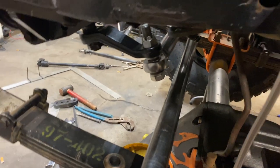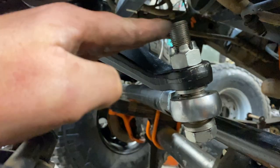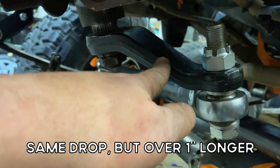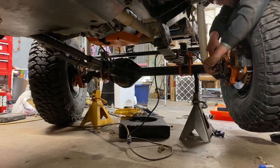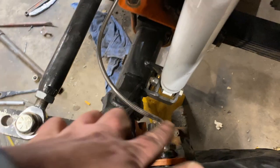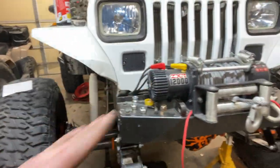I twisted off both of the bottom bolts so I had to cut a door out of the frame and build a new nut plate, then welded it all back shut. Right now I need to flex this out to figure out how bad it's gonna hit, but I can't do that in my garage - I just don't have the height. Option B is to go to a flat pitman arm that would be way up here - I think the stock Wagoneer pitman arm is flat. I went with a drop arm, so the drop Wagoneer arm is about the same as the stock YJ arm. The only thing I can do to move forward is finish getting the radius and grind some of these front steering stops off. I ground some off the back ones and made them level with the front, but like an idiot I didn't have my alignment right.